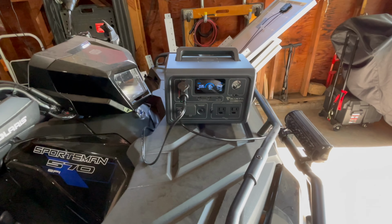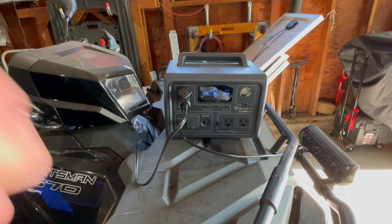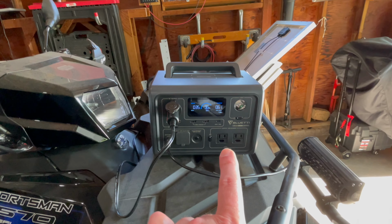But let's come back in a bit. The IceCo GO20 cycled on, but I kind of forced it to. It's pulling 43, 44 watts. I forced it to because even though I had it set for 36, every time I looked at the thermometer, it was about 50. That's a pretty big difference. Now, I know I'm in a very warm garage, but I'm not in direct sunlight. So I cycled it back on by lowering the temperature to about 30 Fahrenheit. But that kicks this on, and you could see it does ramp up when it has a lot more temperature variance, let's call it, to cover.